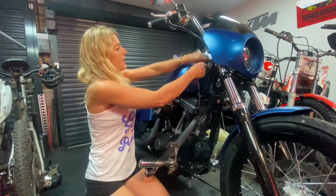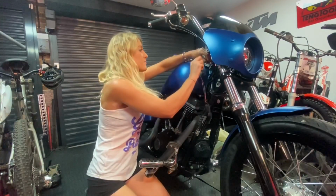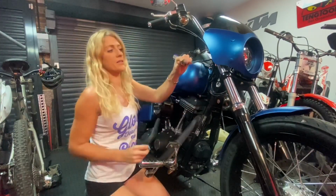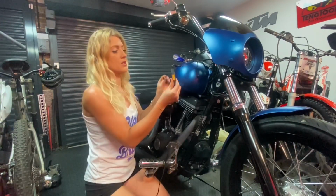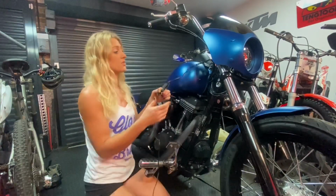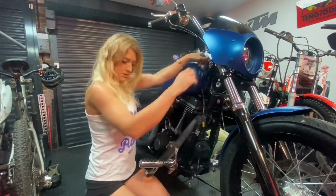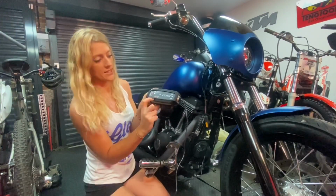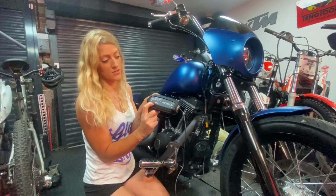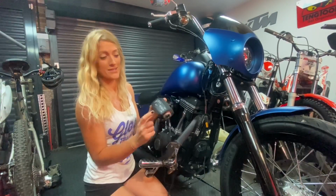Okay, I'm here with Thug, and here we have an attachment that goes through to the battery. This just plugs straight in to a CTEK pigtail. This is a pretty standardized clip. CTEK clips in, so all I need to do when I drive in is unplug that, plug it in, and then the CTEK is immediately doing its thing. It's recognizing that it's a motorcycle battery, and it's gonna naturally go through its 8 stages.